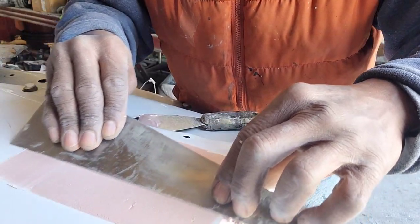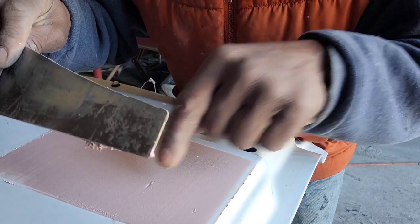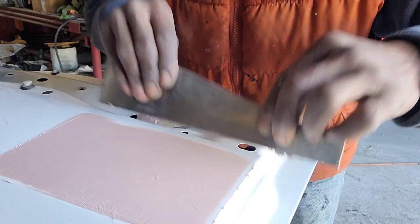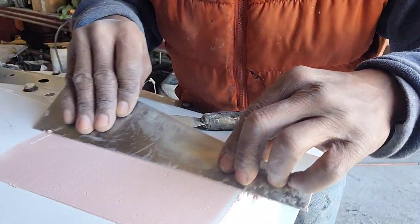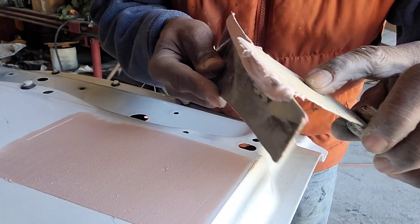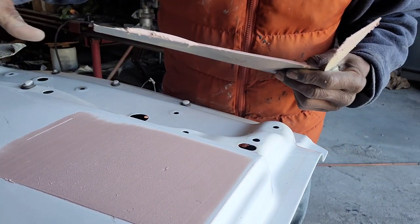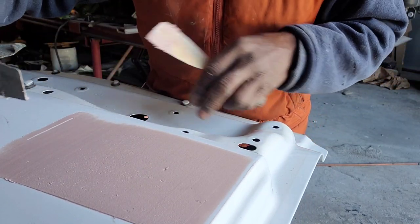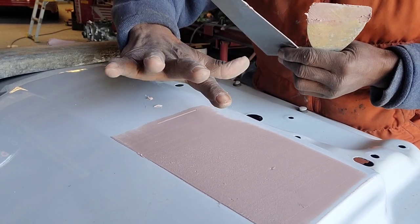Okay? So as you're applying, you're looking at what's happening. Alright? So you see there is dirt, some, because it's a cheap Bondo. So it doesn't matter. This is just demonstration. Alright? So you see what you do. So now you clean this area. You do that. Get rid of that. And to do this section now, you're gonna wait for that to dry. And then you'll come do another coat here on this side. So I'll wait for this to dry.